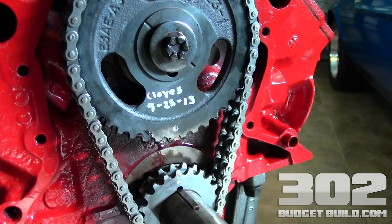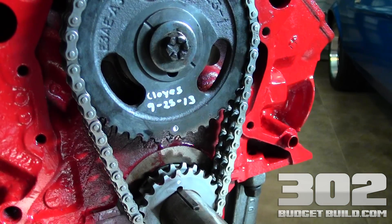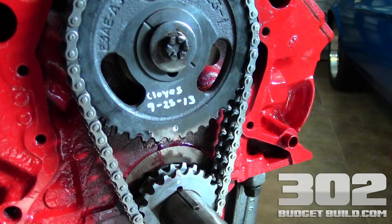So you need to jump onto Summit or go to your local racing shop and get yourself a fuel pump eccentric that'll fit your 302. This common 302 uses a 3/8 inch bolt — don't get the 5/16ths or the 7/16ths one, get the 3/8 inch bolt one from Ford Racing. So you can go ahead and have this ready, but don't impact it down yet. Wait for your eccentric to come in — that's going to be the next step.